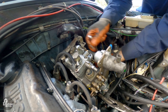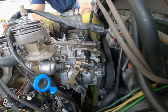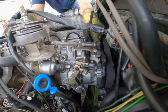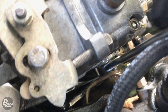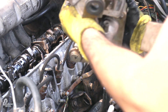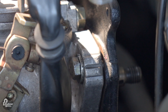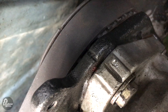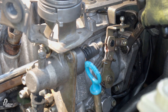To reinstall your pump, loosen but do not remove the five screws securing the mounting bracket to the engine — this is easier with the pump removed. Two of the screws are on the passenger side, one is below the pump attached to the oil dipstick, and the other two are in front of the pump. Reset your injection pump onto the mounting bracket and ensure that the V-groove on the pump is set slightly clockwise of the V-groove on the mounting bracket, as seen from the front of the engine. Fully tighten the pump to the bracket.